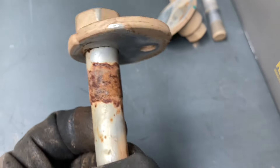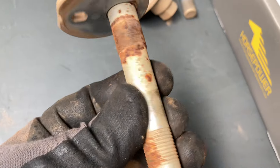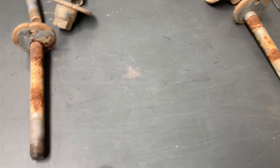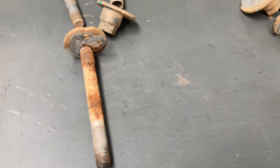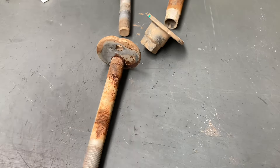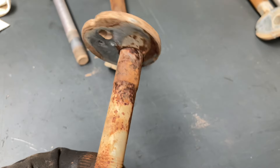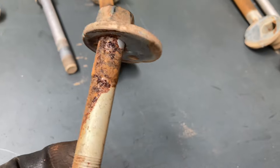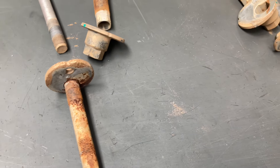I've never seen problems with lower ball joints. This is passenger side, driver's side — this is the rear, this is the front. You can put a little bit of grease on those bolts — good materials but eventually they rust through. I will give it a clean up and put some grease on it. They leave them dry for a reason — could be a good reason — but maybe they just didn't know Australian conditions for 500,000 kilometres, because that's what we want out of these cars. We're not just after four years and then sell it — that's not the life of a vehicle in Australia. Subscribe and don't miss these videos.